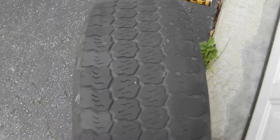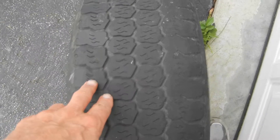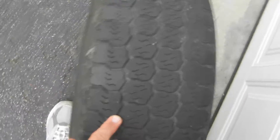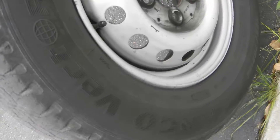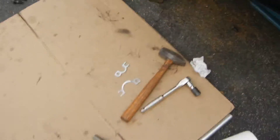I'm going to put a half-degree wedge in this chassis. That should correct this problem. I'm about ready to put on some new tires anyway — these have 103,000 miles, they're the original tires. They're Goodyear Cargo Vector R 225/70/15s.